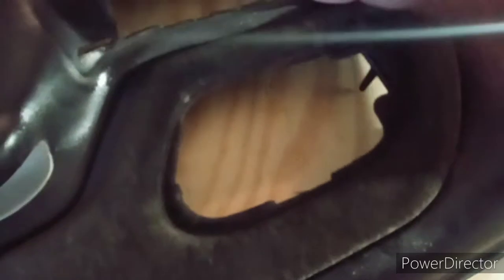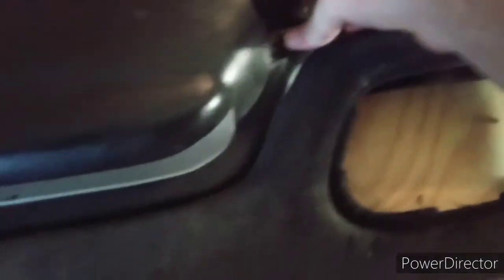I got both door panels inside, up on my makeshift work table. I've got a butter knife in here — you just slide it in and then pry up on it. Use two hands and just go around the entire perimeter. Where it starts to get tight, just be careful because that's where a clip is. You obviously don't want to bend or break it, and then you just pop the panel all the way up like that.